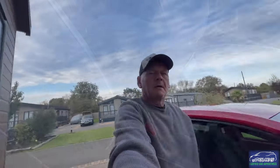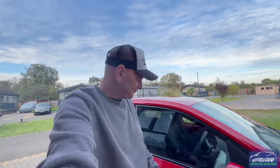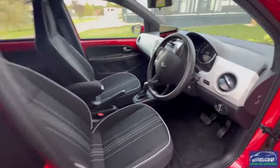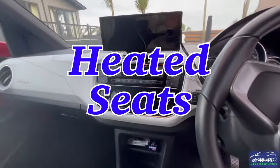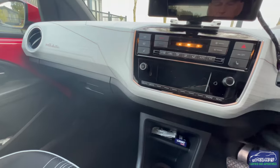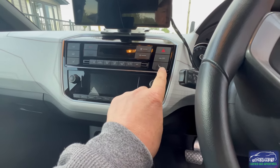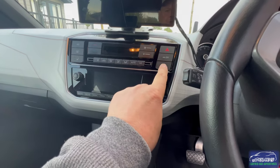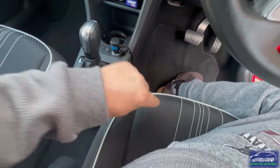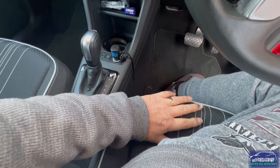Now what's gone wrong - yes, something has, which surprises me given people's praise of Volkswagen and Seat. It's a minor thing. This side works perfectly - the switch comes on, two yellow lights stay on. The driver's side: I clicked it on a couple of days ago, the light came on, stayed on for about two seconds, then went off. I believe there's something wrong with the heat sensor underneath the seat. I checked and all the wiring seems fine - nothing burnt out - so I believe it's just a sensor.